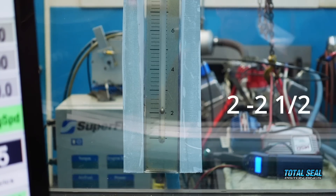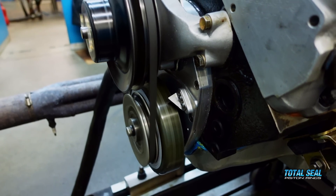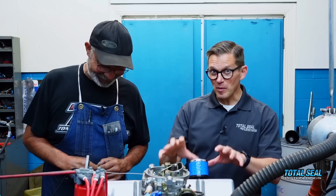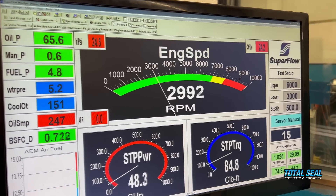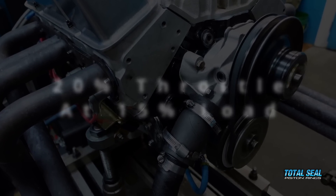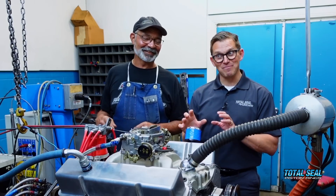Just mind-blown how much better it was — all the way from the start too. When we first fired this motor up, we've got breathers on the motor to break it in. When we first fired it up, there was nothing — no oil smoke, nothing coming out, because it just wasn't breathing. It was sealed up so much better. The first thing I noticed was the throttle: last time to run at 3,000 RPM at 80 foot-pounds, it took 20% throttle. Today, 15% throttle — which means the engine is much more efficient, sealed up so much better.